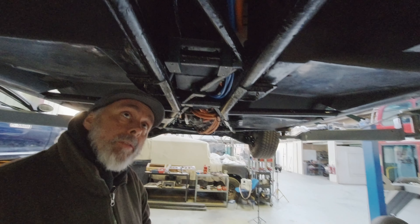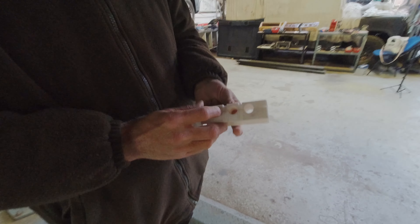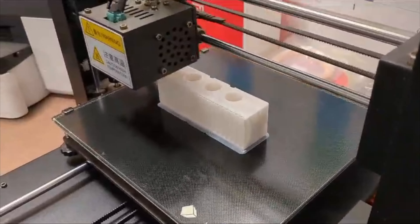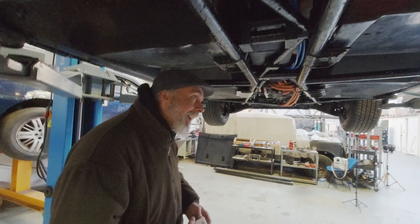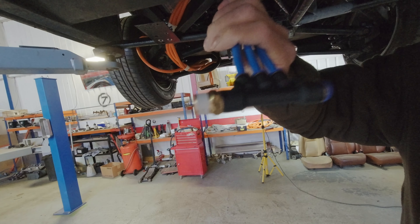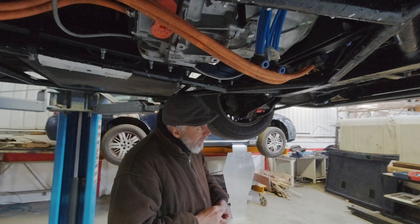Because we can't alter the chassis, Ralph has 3D-printed cable clamps — two-part, bolt-together clamps that hold the cable in place and are simply tie-wrapped onto the chassis rail, with no modification to the chassis rail whatsoever, which is very important for the DVLA. We've also got the blue coolant pipes — they're not cables, they're coolant pipes — coming from the battery cooling plate into manifolds, then through adapters onto the main cooling pipes that go to the front. We're actually using the original TVR radiator, which is a nice touch.